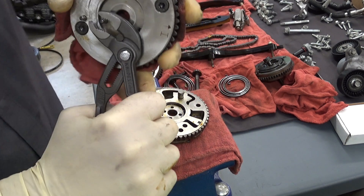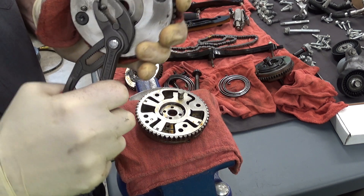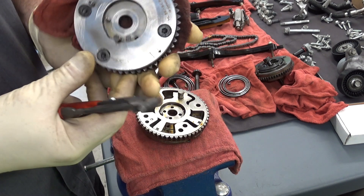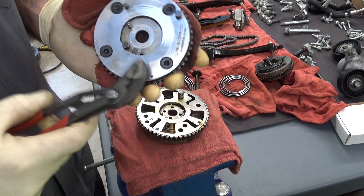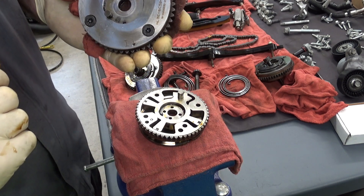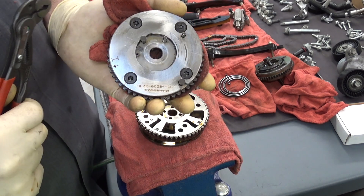That's what rattles — when you shut it off they'll be quote locked. The pin's in there, but the second you start it up, for that split second before there's oil pressure, the camshaft's just going to rattle violently until oil pressure builds and then it sends it back over until it's locked. I've done a bunch of these and I've had quite a few questions about what exactly the issue is. I've seen online people say oil pressure and other things, but it is this locking mechanism that is the problem. My guess is the updated units — they've got a new part number — have addressed it, at least hopefully. Alright, take care guys, see you in the next video.